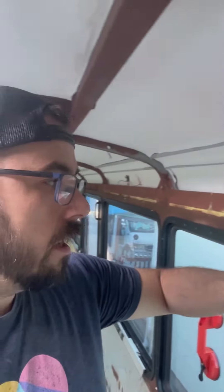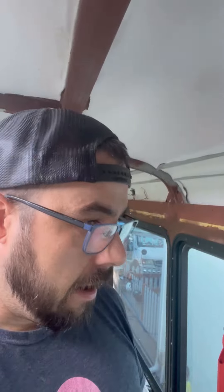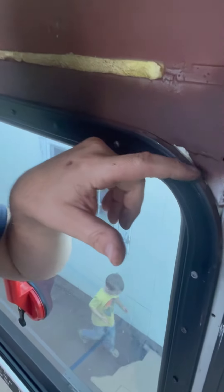For the rest of these I used a polyurethane sealant as well as the butyl tape, and we also went into the corners and sprayed in expanding foam so that it insulates better. We're hoping to get both sides of the bus done today, but I'd gotten some sealant from the ReStore and went to use it — it wasn't coming out of the caulking gun at all. I broke two caulking guns from the ReStore in the process, and it turns out the stuff had expired in 2015. I was able to go pick up some equivalent and a new caulking gun and we busted it out real fast.